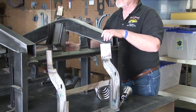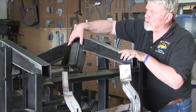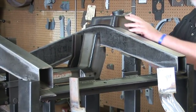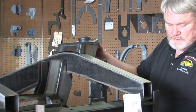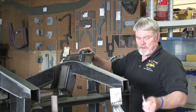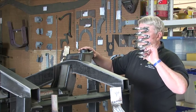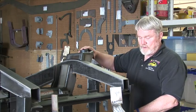The next thing you see here is our Mustang 2 center section. This gets welded in and spotted here. Once we weld that in, we put our Mustang 2 hats on it. With the hats we have different options — we have the coilovers, which are adjustable and can go in here. They come with coil springs, or we have just the option with coil springs with shock absorbers.